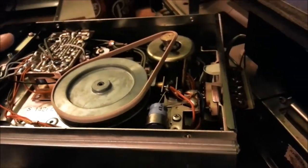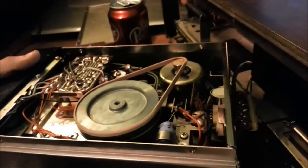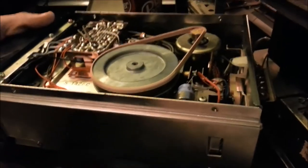I got a ton of rubber bands. I got a rubber band on the son of a bitch now. Check it out — we got my Elvis Presley 8-track here. I got her all taken apart because I thought the motor wasn't working. But the ghetto belt I made before was just way overdone. Apparently a rubber band seems to do the trick pretty good. I might still try to dissect a VCR to see if I can get a belt from that.